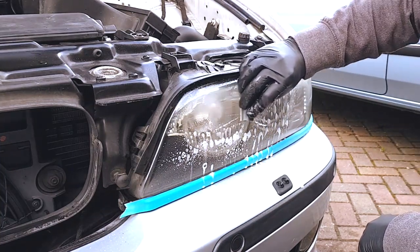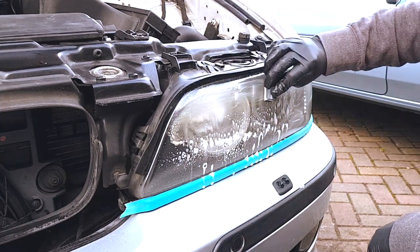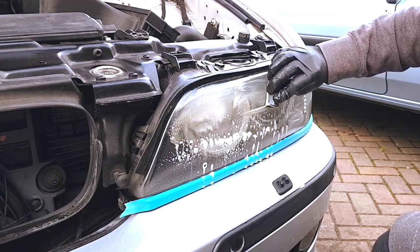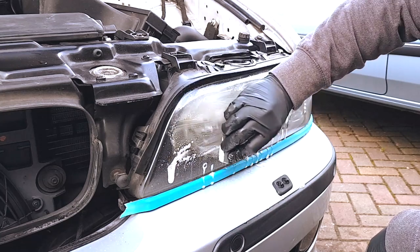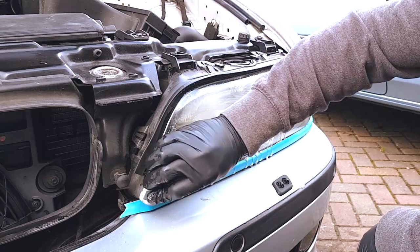If you put your head around it that way, we didn't want the mess that was on the headlights, so we sanded it off, but in doing that, we replaced that damage with 800 grit sanding marks. And then progressively, as you work through those grits, you're going to be finer and finer in that level of damage until you hit a point where it's something that you can buff off with the machine polisher.